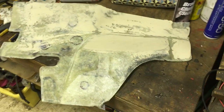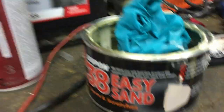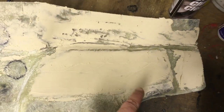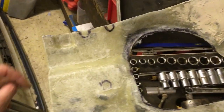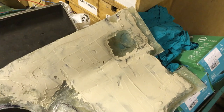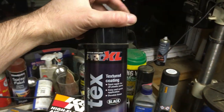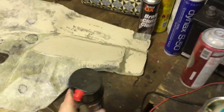I've trimmed the panels up, fitted them in the engine bay, and they didn't look great, so I've put a thin skim of easy-sand filler on them. I haven't gone mental because a lot of it you won't see, but the big flat areas - like on the nearside where the engine bay is quite empty - I'm making sure look nice and smooth. On the driver's side, the header tank, brake master cylinder, servo, clutch, and steering column disguise most of it. I've just dressed the centre, and tomorrow when it's hardened I'll flatten it off, then apply textured bumper paint. Depending on what nozzle you've set, you can change the surface texture.